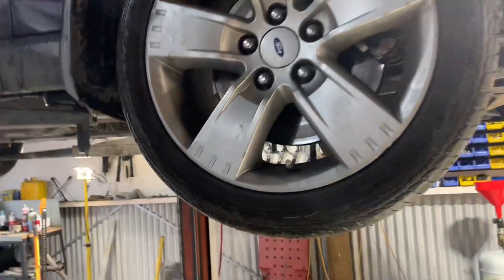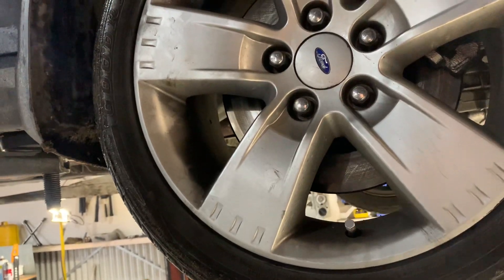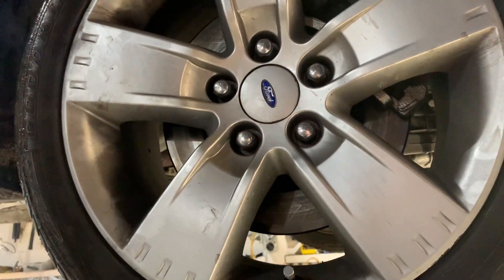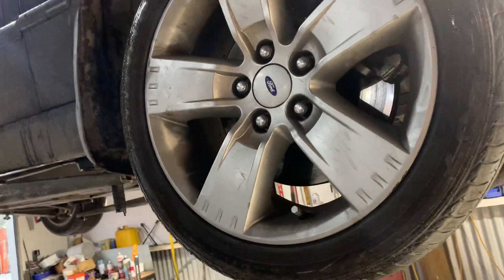The brakes are good — I've already put a couple hundred k's on them and they feel great, as new brakes do. I paid about $200 for the rotors and $50 to $60 for the ceramic pads — same as what's on the back. I always get RDA because they paint the rotor so only the contact surface wears to bare metal. You can still see a bit of paint wearing off. I don't like Repco's brake brand.